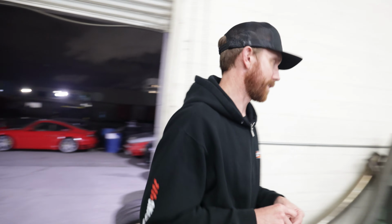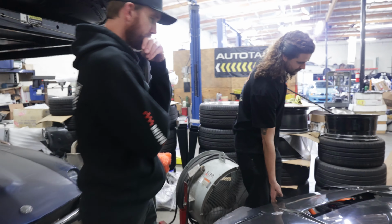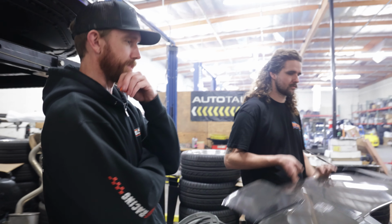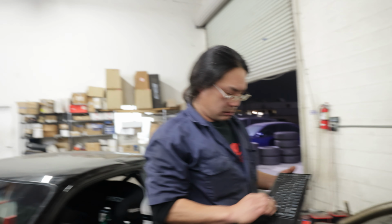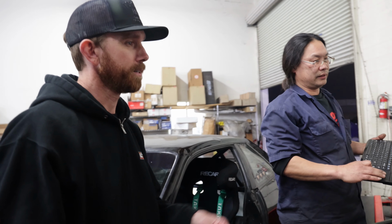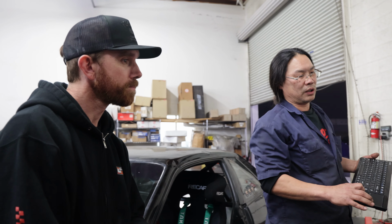That's what I was saying. I don't know why it's doing that so hard. That's how it was driving before. It used to be super peaky on the old setup, on the old engine. And when we put the new motor and everything else on there, I attributed it to the turbo size. Yeah, I noticed it was rolling over pretty hard. I thought maybe it's because we're not in the efficiency range, and it does look like it just richens up, but it drops off hardcore.